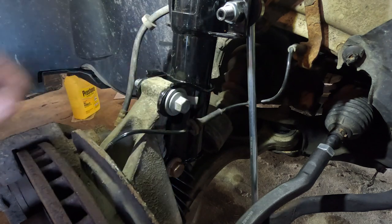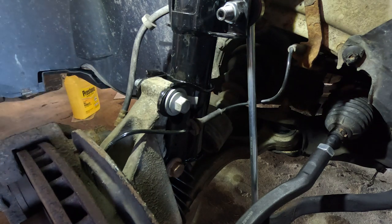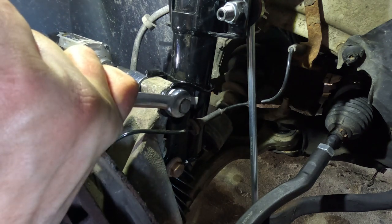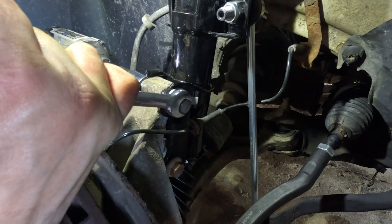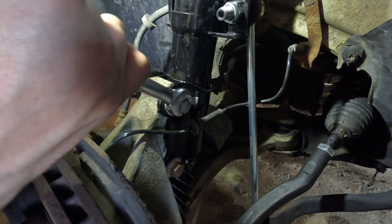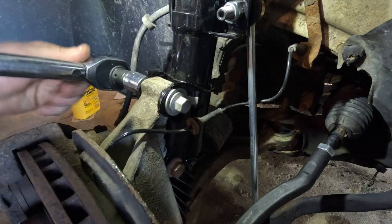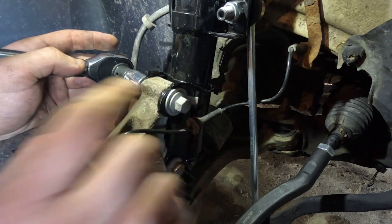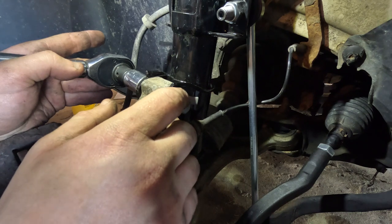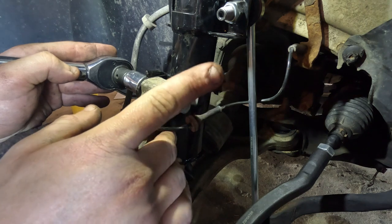Okay, so we kept our bolt right about where we wanted it. I don't really see a problem with it there. Okay, so we have our bolt right about where we want it. Now, you do want to torque this down to 97 foot-pounds, no further, I guess. I don't know, it says in big writing on the thing not to over-torque it, so it must have a chance of breaking or stripping out or something, but anyways, we're going to set it to 97 foot-pounds here.